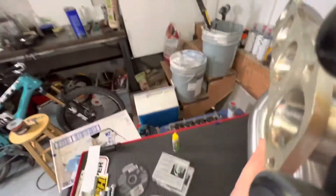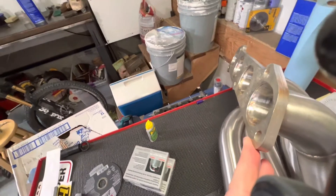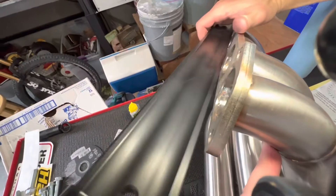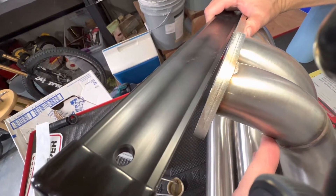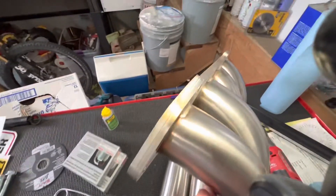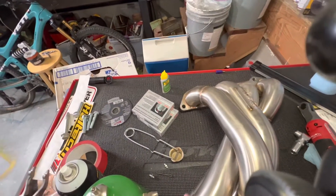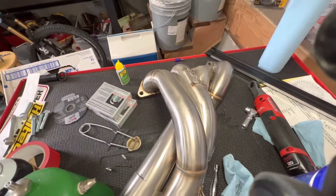I guess that's kind of expensive, but check this out — this flange is super warped. Look at this. So this is a straight edge — oh man, this is hard to do with one hand. It's flat on the other side, but it's like a quarter of an inch plus out. I'm going to have it machined, but even then it's so far out the bolt surfaces aren't going to be flat. I might heat it up and bolt it down on a steel plate and let it cool and see how much that flattens it out, and then from there I'll probably have it machined flat so that it fits.